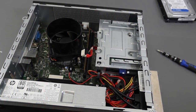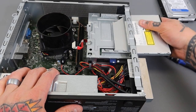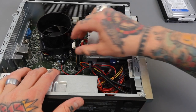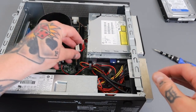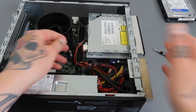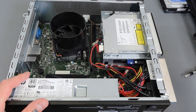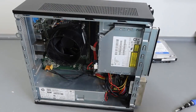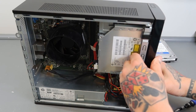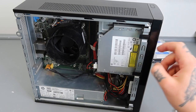That's secure in there. Now we're going to add the disc drive back in. All you need to do is slide it into place — you may have to pinch the tab just to get it through the opening. Rock it back and forth gently; don't force it or you risk damaging the end pieces. We have two connections: the larger one goes on the bottom and the smaller one goes directly above it. Everything is now locked in place — connections made both to the hard drive and to the disc drive. Now I'm going to take the front panel and put that back on. I like to start on one side, bring it close, then pull the other side into place and push so the three clips lock right into the frame.